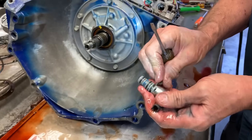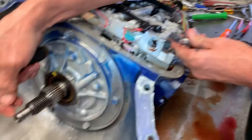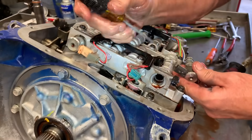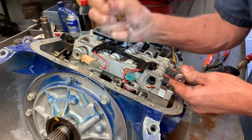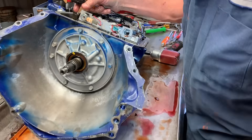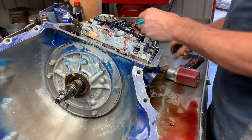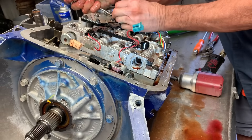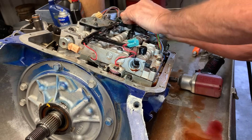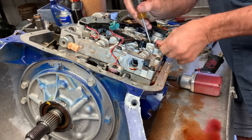This here is your pulse width modulating solenoid that pulsates your lockup on for your torque converter. Now, we come in here and block this valve. Instead of making the clutch pulsate on, we just lock it up like a normal clutch. It'll actually feel like a shift instead of not really feeling it at all — all you'd do is sit and watch the tachometer. When we lock it up like that, it'll actually feel like a shift, and the people think they got themselves a five-speed.